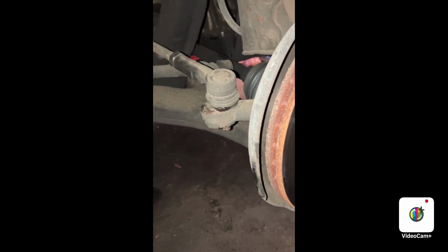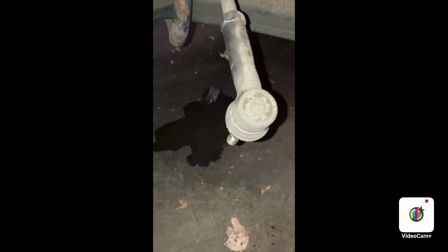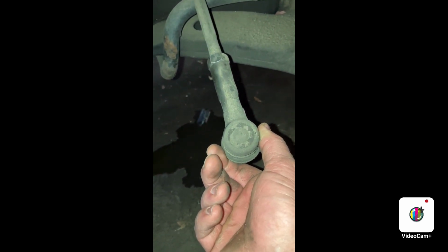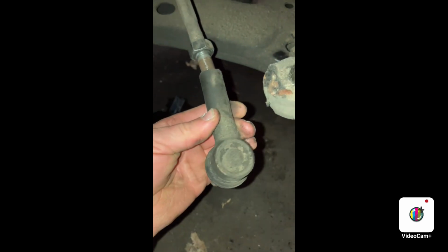Bust it loose. You should have a box that organizes all the different nuts for every part that you take off, in order. See, I have my lug nuts right there. This next one is going to be for the tie rod castle nut. Next, pop out the outer tie rod end. Count how many times you have to turn the outer tie rod counterclockwise. 14.